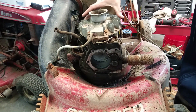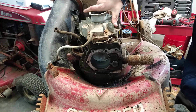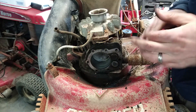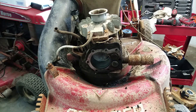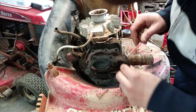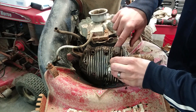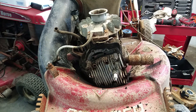I notice whatever oil is coming up in here may have a little bit of dirt in it, so an oil change is going to be greatly needed soon. The oil is dark but it's not gray, so I don't think it's completely done. This machine is probably going to smoke quite a bit, but hopefully it will run now that we've cleared out most of the debris. I'm going to put the head and everything back on first, then the shroud and the pull rope.